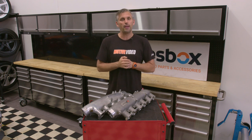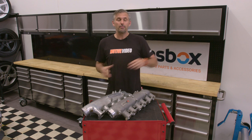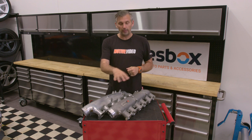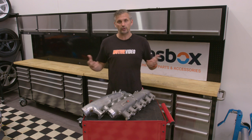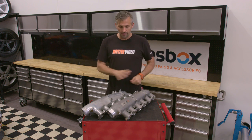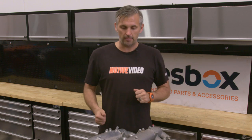On 22 pounds of boost with the G35 1050, the car is still quite responsive but makes decent grunt. So we get to test the power side of it and the response side of it. We can also look at things like: does it change the air-fuel ratio in the back cylinder? Is it more efficient? Does it change the torque characteristics of the car? Before we get it on and test it, we're going to have a look over the differences between a factory inlet manifold and a Nismo inlet manifold.